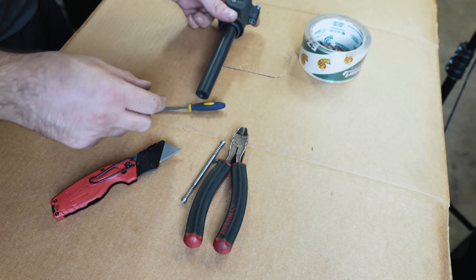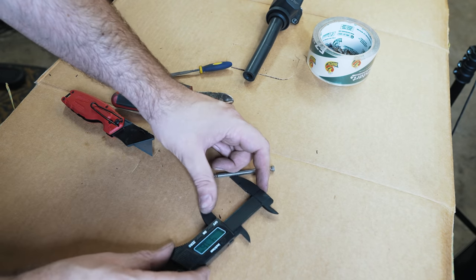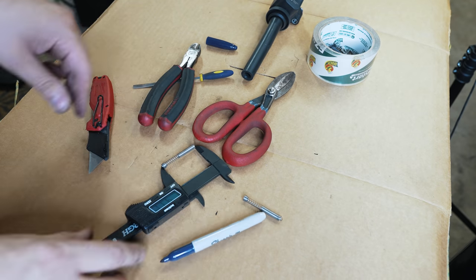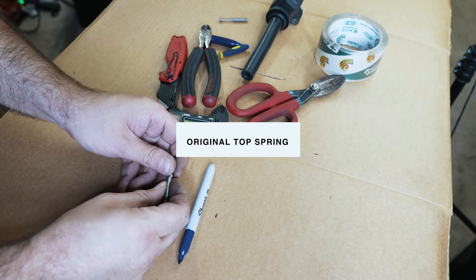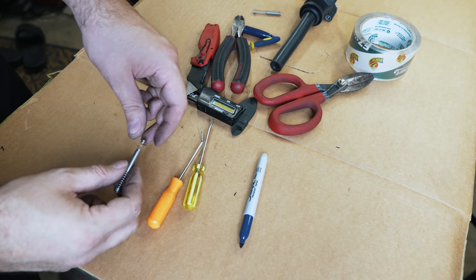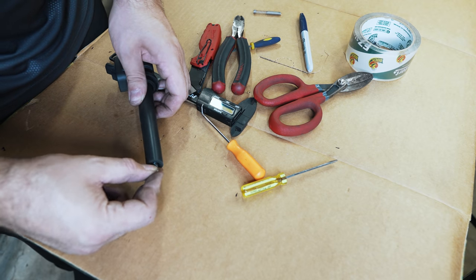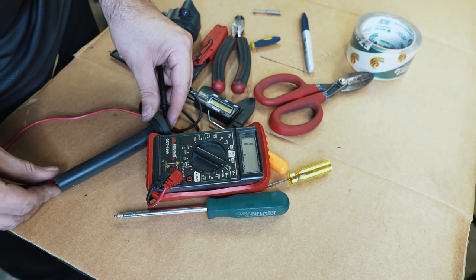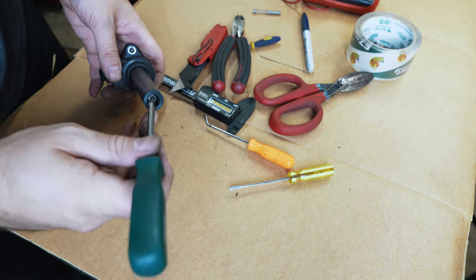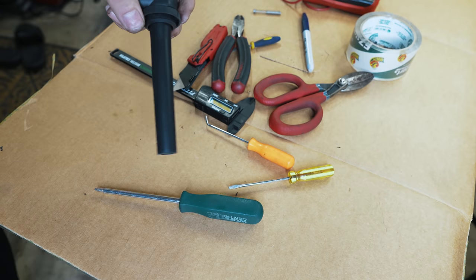The part that was living at the bottom is now going to live at the top so that it sticks out far enough to clip into the coil. You can see the other end of the resistor inside. Now you take the supplied spring, cut it in half - that's around 47.5 millimeters - which is about the right length. Then take the spring and screw the two halves into each other. It's a little fiddly but if you engage it by a few coils it's pretty decent. With our modifications done, I put a multimeter on either end and I'm getting a reading. That spring stays in there nicely because it engages on the wall of the coil. That's one completed - let's put it on the car and see how it fits.